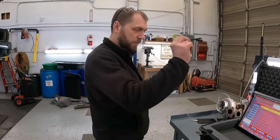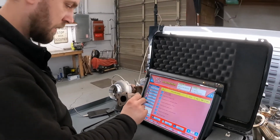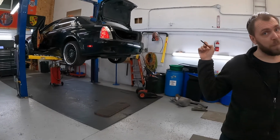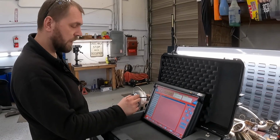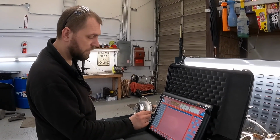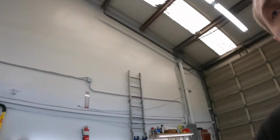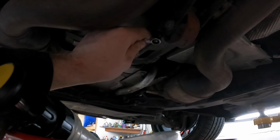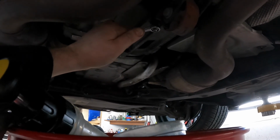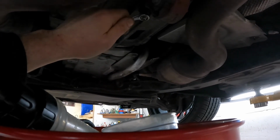Here is the bleeding procedure. First, we connect Leonardo to the Maserati. Then check components. The pump is already pumping. We replaced the relay and the fuse was blowing. We're going to check components. Pick the clutch electro valve, then we have it on and off. The reservoir is already full. Now Ilya touches the button and I open the valve over there. This is the bleeding valve. Okay, on. We slowly open the bleeder screw and then close. Off, please.